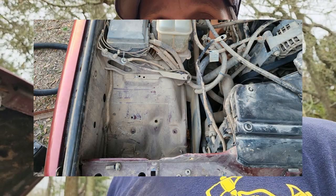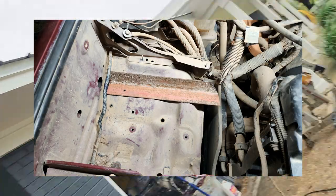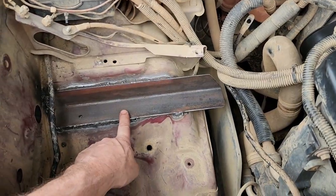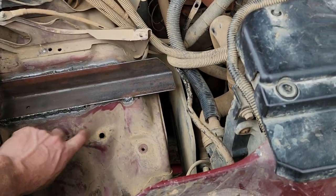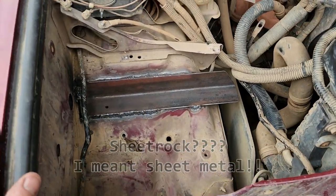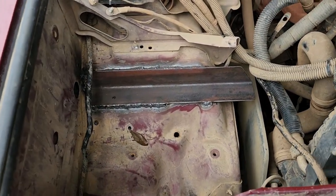You can see where I trimmed out the fender liner and added a piece of angle iron in there, which gave me enough room to get both batteries in. I took a piece of inch and a half angle iron, cut out the fender, and welded this piece in. Not my best welds ever - welding the eighth inch to the sheet metal was a little tricky - but got it in there. Now we're going to get this spray painted and then get the bottom side rubberized and undercoated to get it protected.